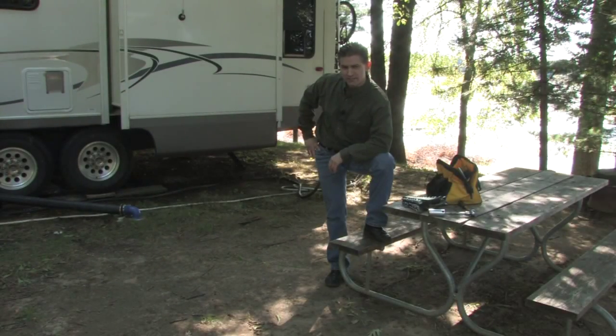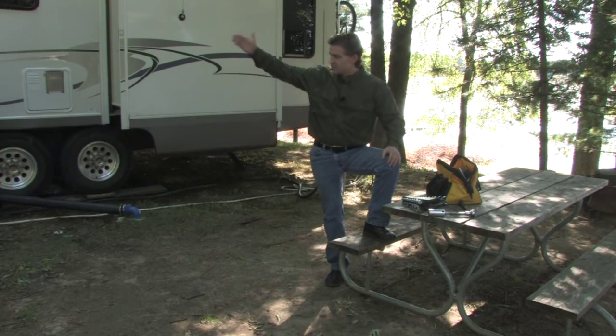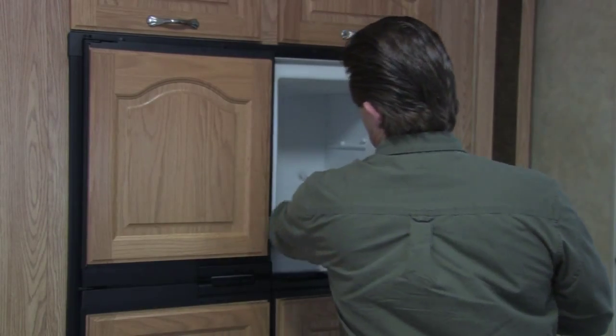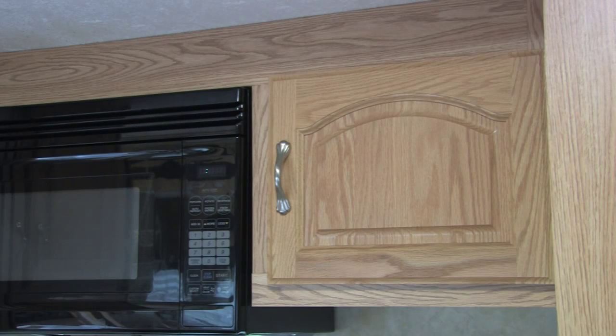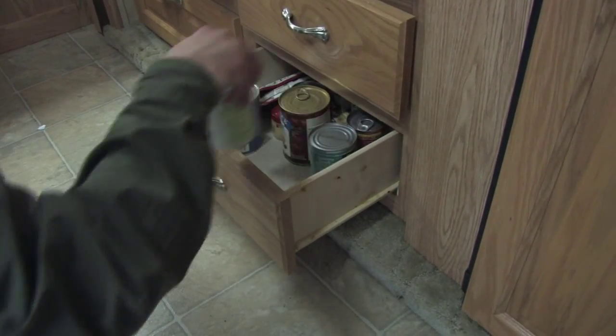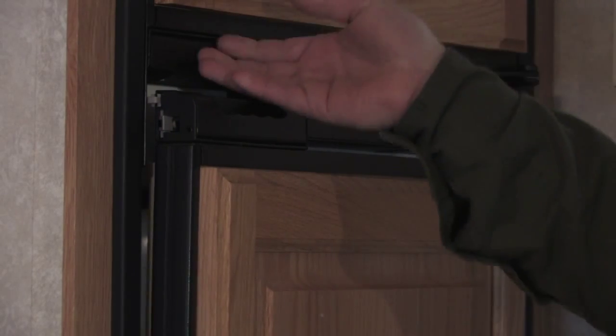It's also a good idea to make sure that you close the black and gray water tank valves before you put the vehicle into storage. If you don't, you risk damaging the seals, which could lead to leaks later on. Make sure you get any freezable food items or liquids out of the vehicle. Check all the cabinets and storage areas. Even canned food should be taken out since they could freeze and split open. Clean out and shut down the fridge and leave the doors propped open before you put the rig into storage.